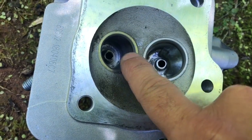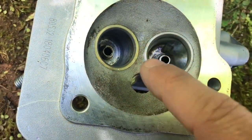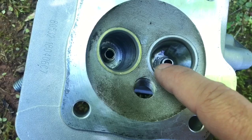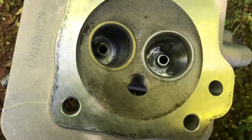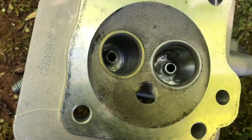One really important part: watch out for your valve seats while you're grinding. With rotary tools, it's real easy to forget about the chuck — it is spinning, and a lot of times it has some grip on it, and you can damage the seat. If you damage the seat to a point where it's not repairable, you've ruined your head.